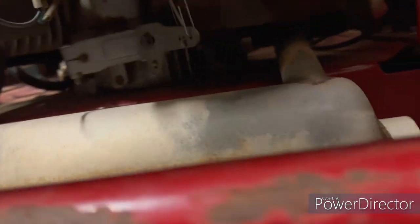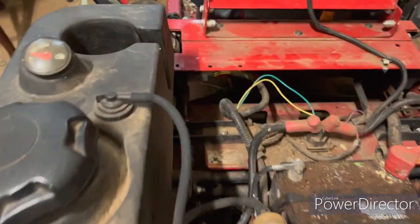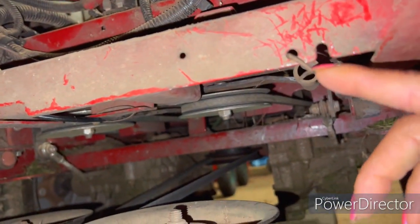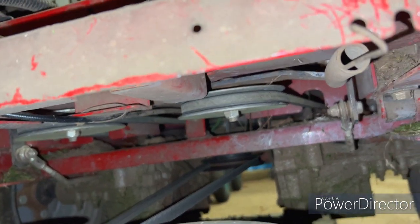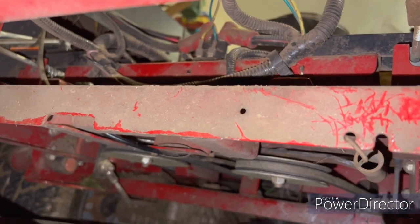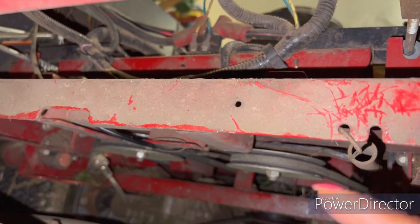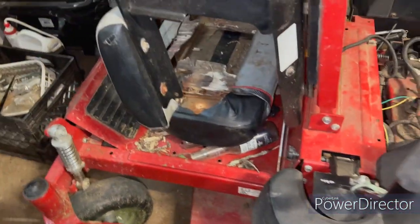These valves pull out so you can move them more. There's a pulley up there on each side. The pulley on the left side has a spring — it's spring loaded. So you need to get a pair of pliers. If you look under here, right there is the spring. If you go in the back of that and release that spring, then that pulley right there will move. This is a Ferris 400S. That spring right there releases that pulley so it'll move back and forth. This is on the left side of your mower. This is a Ferris 400 zero turn.